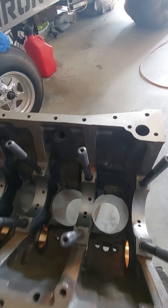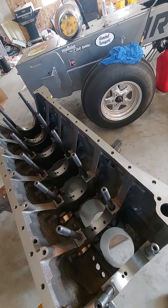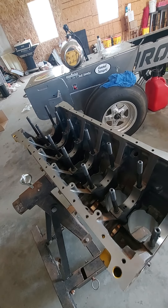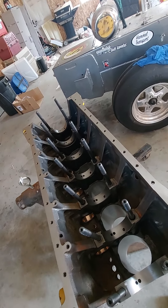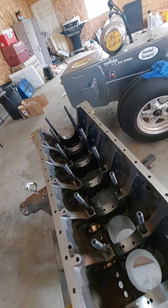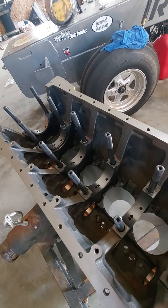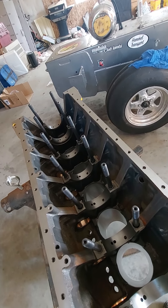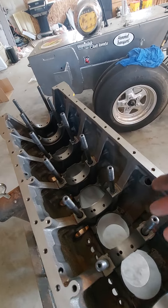That's what it takes to handle the horsepower we run through this little motor. The motor is not that big at all, and the machine work on this thing is unreal — the amount we have to put into it just to get it to last. A lot of people go to the 6.7 blocks because they tend to be a little stronger. On the underneath side where you see the O-rings, they'll take a one-inch thick steel plate, attach it to the top of the motor, and sleeve the motor. This block here does not have sleeves — it's a bore just like a common V8. A lot of diesels have sleeves pressed in, and if you hurt a cylinder they're easy to replace.